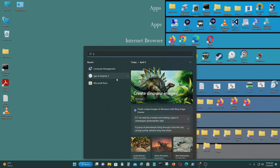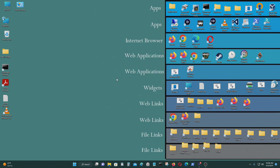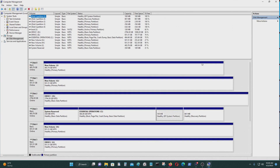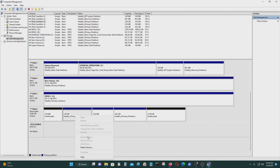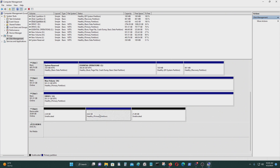I have my micro SD card USB reader connected to this computer so I'm going to type in computer management and do some stuff. This is written over already so I want to delete all the partitions on this micro SD card. If this is a new micro SD card you don't have to do this. Maybe it's not even necessary but I just do it because I want to make sure the partitions are clear.